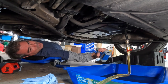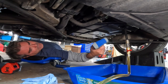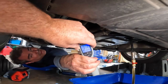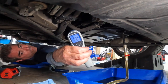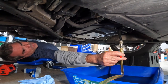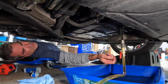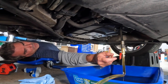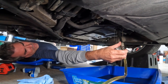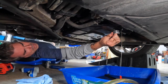We had some problems with the equipment — the Durametric wouldn't connect properly and the iCarSoft wasn't reading the temperature properly. So we're going to use just the standard old infrared thermal gun. Right now we're at about 20-some degrees Celsius and we've got to get to 30. Mick is going to monitor the temperature while I'm going through the gears. Once we get between 30 and 40 degrees Celsius, then we'll top it off again. We can see we're at 37.4 right there, so we're between 30 and 45 degrees — we're coming out pretty good now.